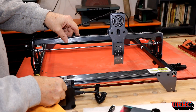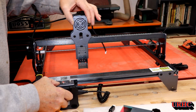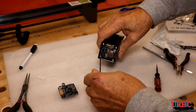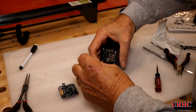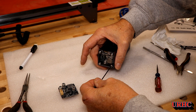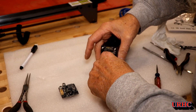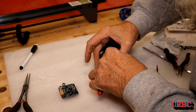I put the X-axis back in and got everything moving really nice and smooth. The motor is making a little bit of a grinding noise too, so there may be a bearing issue in the motor as well, but I'm not going to mess with that for now. Then it was time to replace the laser control board. If you watched the other video, after about an hour of use it went from a nice clean engraving and cutting to a smoky, discolored look and I couldn't get a clean cut in anything.